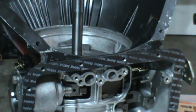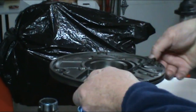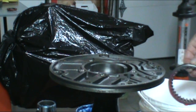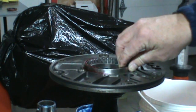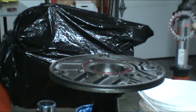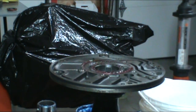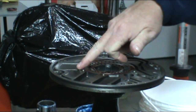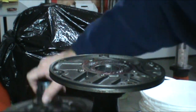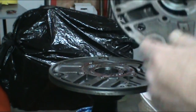Okay, so we're going to go ahead and put our pump together. We've got our new O-ring out of our kit — go ahead and put that on the pump body. We've got our brand new gears — we've measured them, they're within half a thou of the old gears. Put some oil on these gears. If you're not sure, get a straight edge across here and measure it. When measuring with the straight edge, 3.5 to 6.5 thou is the tolerance for the pump. We've got our stator — this stator has the bushing in it for the input shaft. Go ahead and line our two halves up. Now we've got our five pump bolts — these are the bolts with the five lines on them.